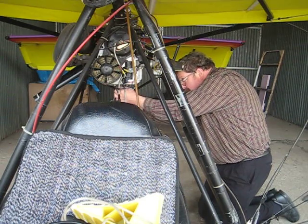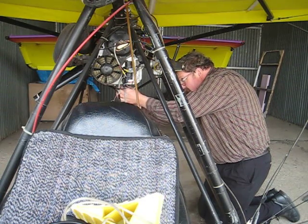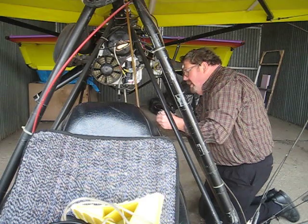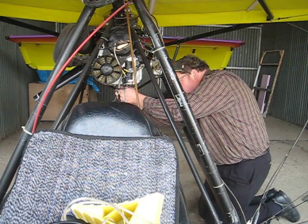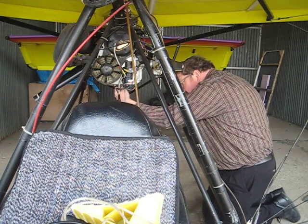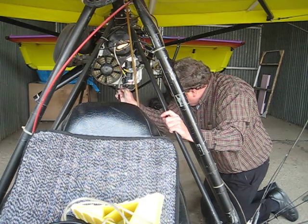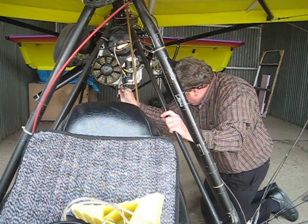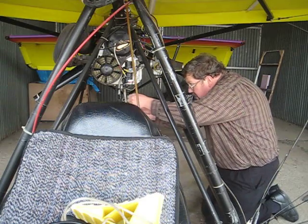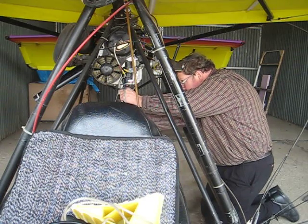I think I may have caught the thread or slightly cross-threaded it because it doesn't want to turn anymore by fingers. I'm going to back it up and start over to get that thread catch nice and cleanly. Part of what's going on is the safety wire actually gets in the way of being able to get those threads started, but that seems to be threading in nicely now.